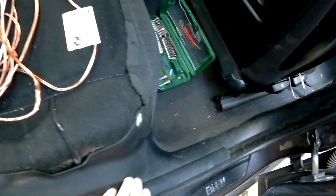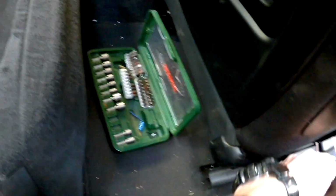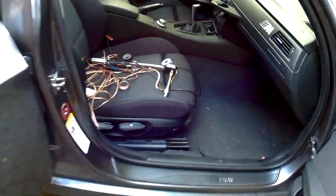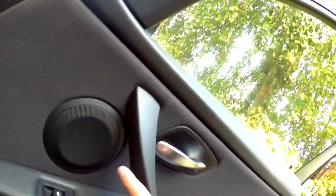and then we're going to take the whole side apart here and just follow that line to the front speakers, where they come out of the radio, somewhere like here I would say, and then it spreads to a cable going into the door speakers and going underneath the seat into the sub, and we are trying to find this point where they're spreading.